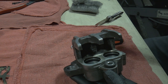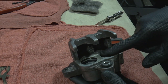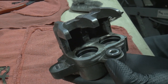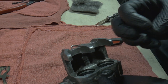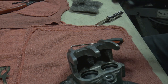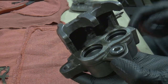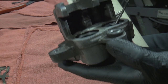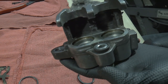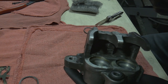Here's a side rant — my wife's a dental hygienist. When you have calculus on your teeth, it's hard to see because of saliva. Similarly, if you have buildup inside the brake caliper, it's hard to see because there's brake fluid everywhere. As soon as she uses air and sprays it on a tooth, it makes the calculus turn bright white — that's how they know where to scrape. Contact cleaner works exactly the same way. When I pop these seals out — get a little pick and go right underneath there and work it up — these are the lands inside that you want to deal with. They are square lands, so they fit the seal. Hit them with contact cleaner — it's going to expose and dry everything up so you can start scraping at it.